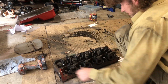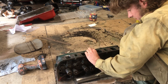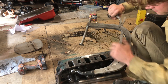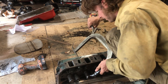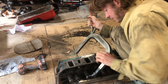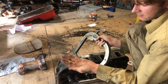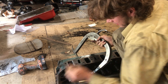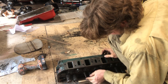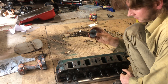Alright, we'll work on this a little bit. Once you loosen up your valve keeper, grab the compressor, open it up, go ahead and lay it on here. The cup here goes in the valve — take this and give it a good squeeze and hopefully this will pop loose. There it goes. Don't lose these — those little guys are called valve retainers. You don't want to lose those, keep track of them. Now we'll go ahead and take this valve and pull it out. This one's actually in surprisingly good condition — 194,000 miles on it. What we've just done is removed the valve so we've exposed the inside of the chamber here.